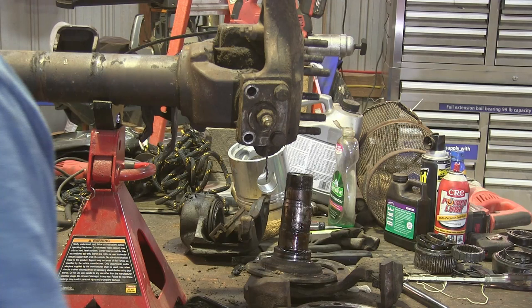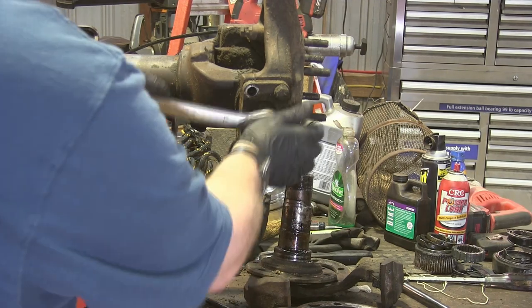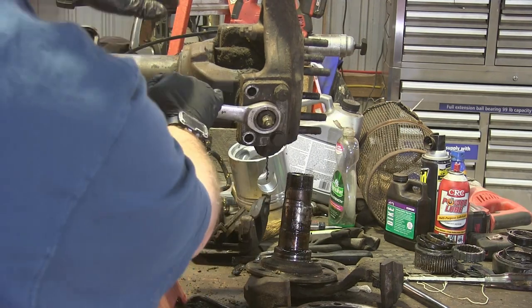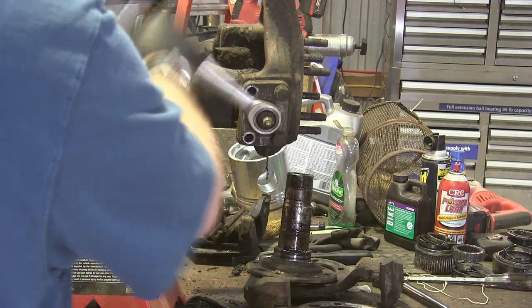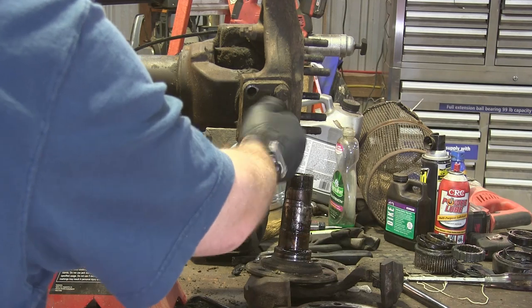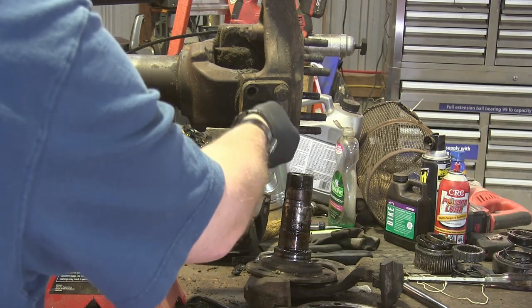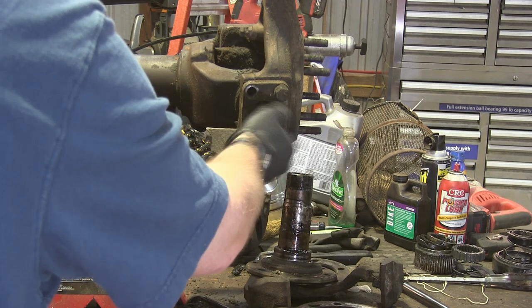My bottom kingpin caps are quite a bit different than normal ones. These have adjustable camber in them, so they'll disassemble quite differently than a normal one. We're going to remove two bolts on one side and leave two bolts on the other. That lets me get this one-inch nut off the adjustable camber part. You take this nut off and there's a washer behind it — that bottom plate has a recess for that washer, which is what locks in your adjustable camber.